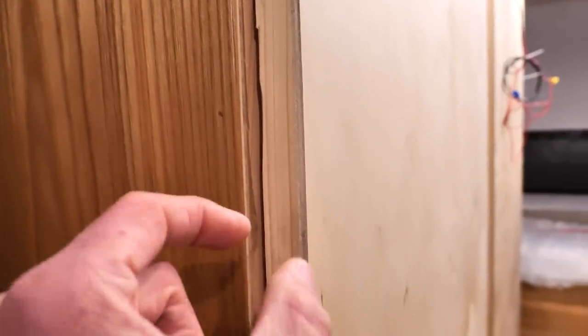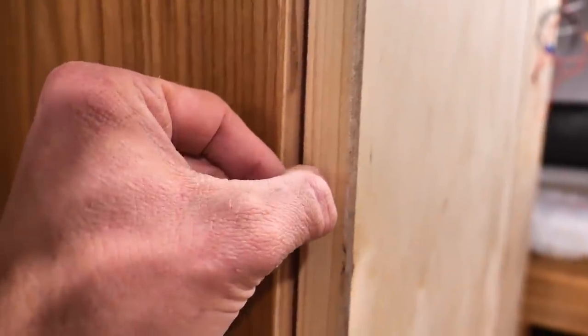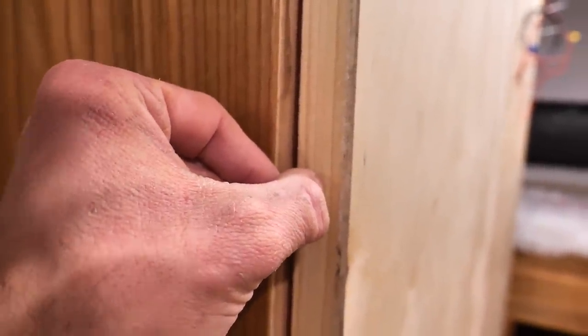And then I was telling you earlier about the rabbets. So the way the walls come together is it's going to come flush to this wall, and then we're going to cut a rabbet in, about to there. There'll be about 3/8 of material, and it'll connect to this wall, and then we'll make a nice L trim piece that'll just slide over and cap it and conceal it.